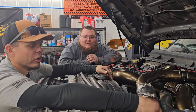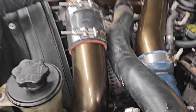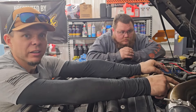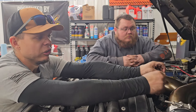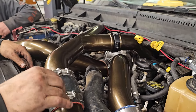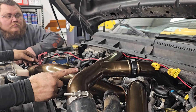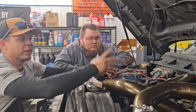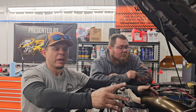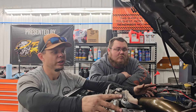For quick reference, make sure your charge air cooler sensor is facing inward on the elbow when you do this. With the two Y-bridge pieces, you lightly thread them together, then press them together, put your clamp on, and tighten them down — snug, but still with a little play when putting them together. From there, you move on to putting your hot side pipe on, then the rest of your cold side pipe. There is also a dipstick tube mount, and the intake comes in at that point. It really goes together common-sense style. We've got pictures on the website, which is why I didn't do a full installation video — I just wanted to show you what it looks like when it's done.